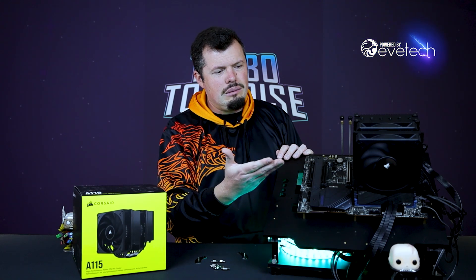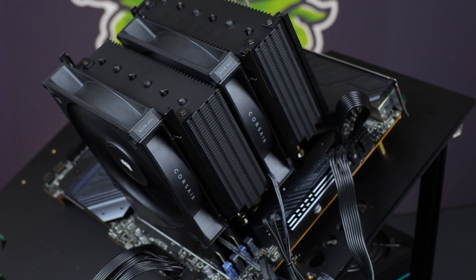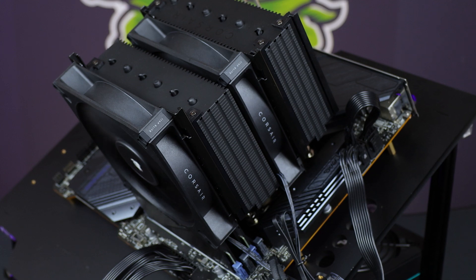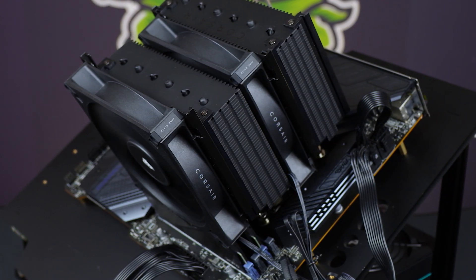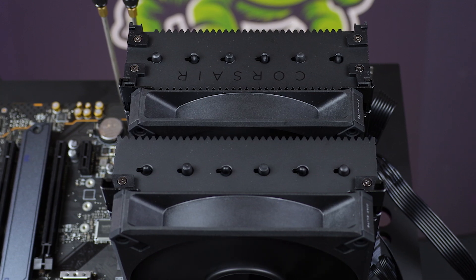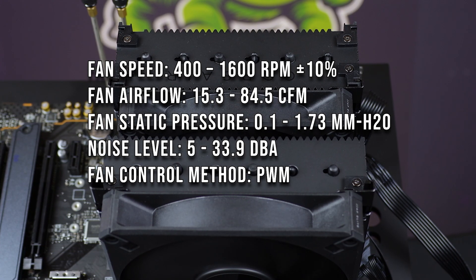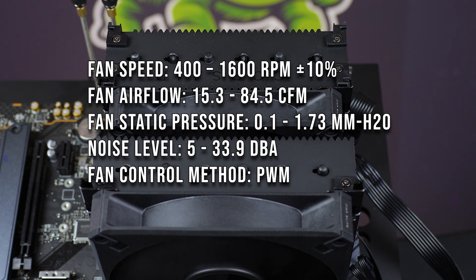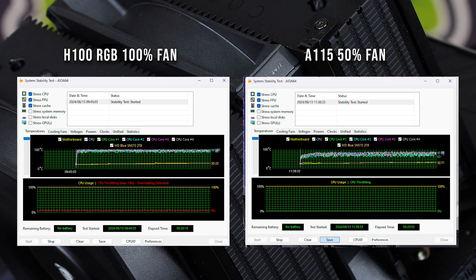You might notice the positioning here sits a little on top of the RAM. I could have done it the other way around, but then it just sits on top of the heatsink by the rear ports — so no real difference. The fan is actually longer than the fin stack, so it's much of a muchness. What I think is happening and why this thing performs so well are these six copper heat pipes going into two massive fin stacks. Then that fan quality from Corsair — if they say AF Elites, they really mean it, and their CFM values are not for show. Their bearings have lifetimes that are unreasonable, which is why they slap on five-year warranties. The result is a cooler that is so ridiculously strong.